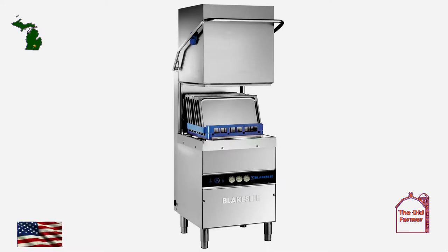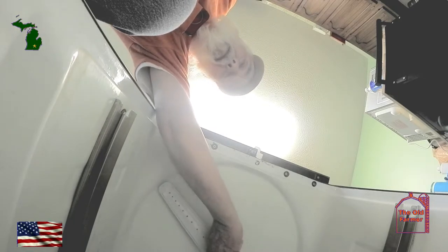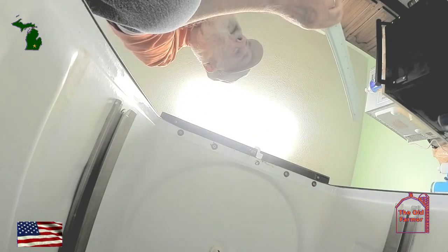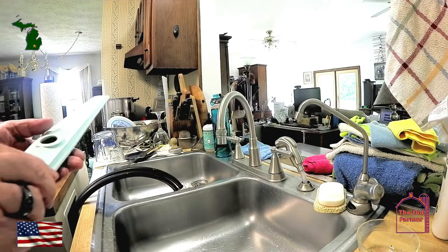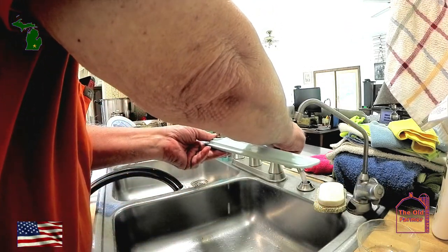What is happening in any dishwasher is the nozzles get plugged, and the liquid can't get to the dishes. So instead of drilling for oil, drill for food particles that may have gotten stuck in the nozzles. On most models, you don't need any tools to take apart the spray arms. Grab onto two different areas, and it either unthreads or it has tabs and slots connecting everything together.